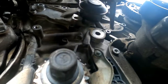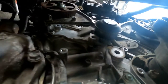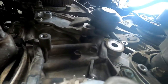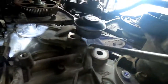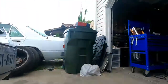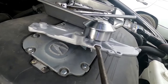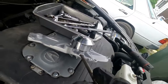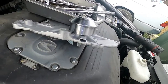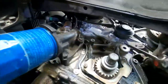I got all five studs out of the water pump from underneath the car — you can see the holes are empty. Because it's been sitting there so long it's pretty much stuck on. I'm going to pry from underneath. There's a gap on the bottom where I'll put a sturdy flathead screwdriver and pry it up. If I break the old part, it's not a problem — we're getting rid of it anyway.